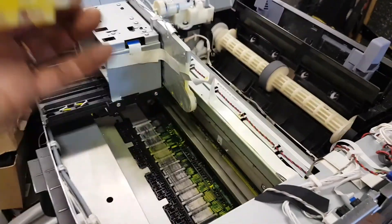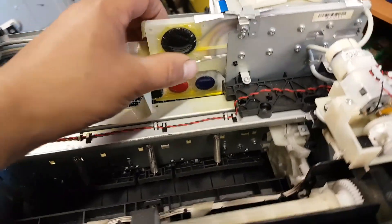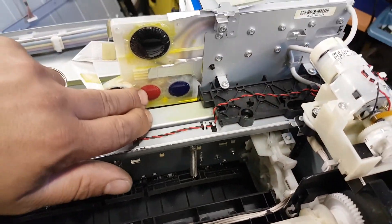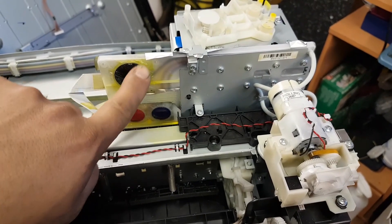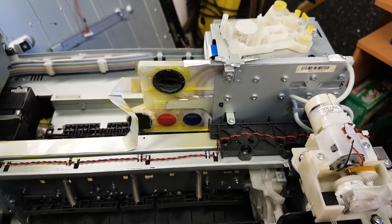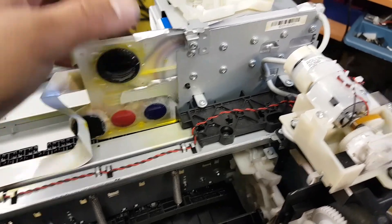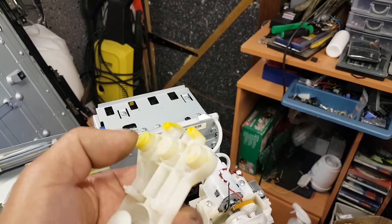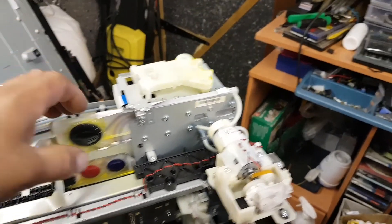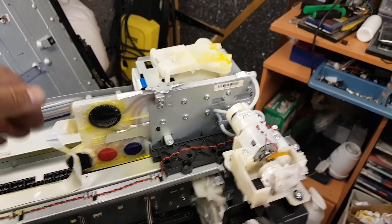I've taken this cover off to show you what's behind. What you have here is a vacuum pump that pulls the ink and fills these pressure areas, then sends it to the printer head. This membrane here, as you can see, is under pressure — and you have a spring-loaded piece that sits on top. There's one for the top and then three others, all spring-loaded. This just keeps pressing the membrane to maintain pressure in the ink.